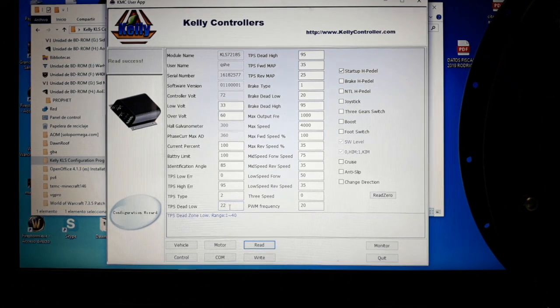This is where the throttle is at zero — meaning the throttle gives zero speed to the motor. By default it's set to 20, but I increased it to 22 because at zero position the motor was trying to start very slightly but noticeably. Increasing it by 2% was enough to set the zero point a bit higher. You can also set the maximum point, where 95% is reasonable — that's where it will reach top speed.